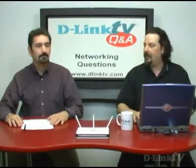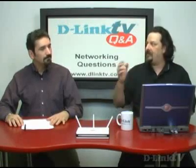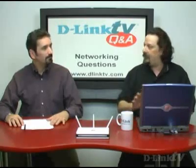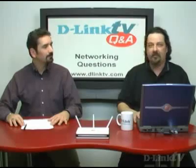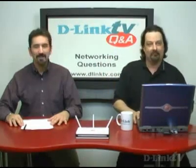It's kind of like USB — you can just keep stringing more and more switches off of it. USB supports 127 devices and with switches it's some really high number, like 65,000. Well, not quite that high, but you do have to worry about distance. Most home users don't exceed the limits, so you won't have to worry about that. Even a small business isn't going to worry about it. Once you get into higher-end 48-port switches, your IT department will take care of it.